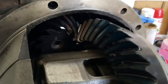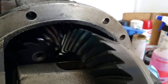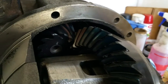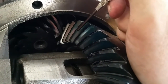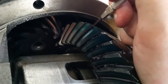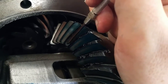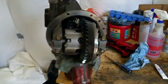Here I'm looking at the pattern the Prussian blue makes on the ring gear where it contacts the pinion. You can see the contact pattern in that area on the drive side. It's not a great pattern, but this is a used gear set, so you'll get some imperfect patterns. Hopefully it'll hold — we'll just have to wait and see.